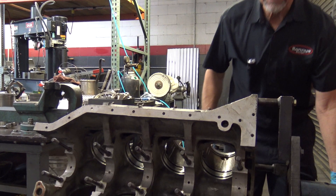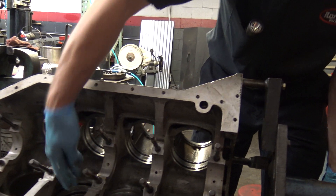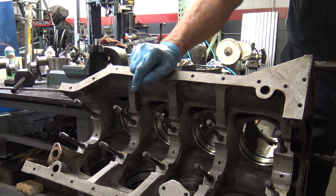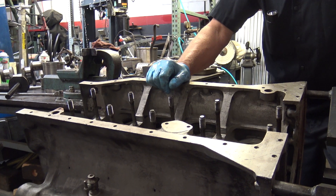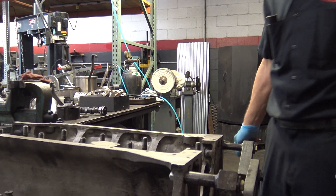The web is where the main bearings are — that's what supports the crankshaft, where these studs are. They crack in here. I have seen a Shadow engine that cracked all the way into the main bearing web. It was a '69 or '70 Shadow. The guy who owned it overheated it good.